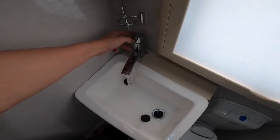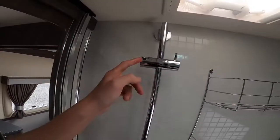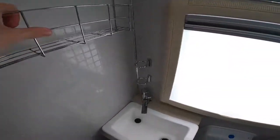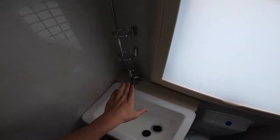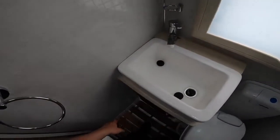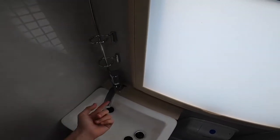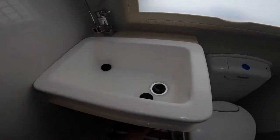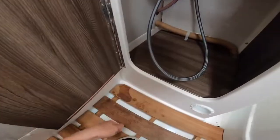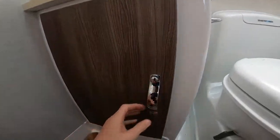In the washroom you've got your hand basin, which also serves as your shower head — just pull it out and pop it onto here. There's a soap dish, towel holder and toilet roll racks. When winterizing, pull the shower head all the way out, take the head off the shower hose and lay it in the shower tray, leaving the mixer taps open throughout the vehicle to stop any water sitting in the lines. The hose coils up behind the sink — pull it through and drop it in the shower tray with the head off to drain any water out of that pipe.